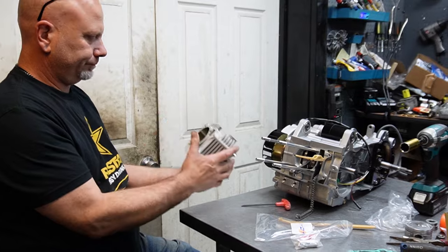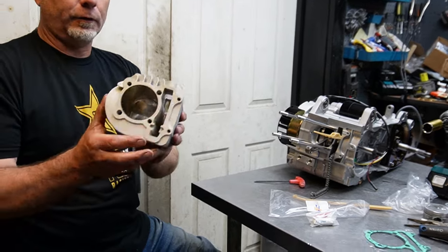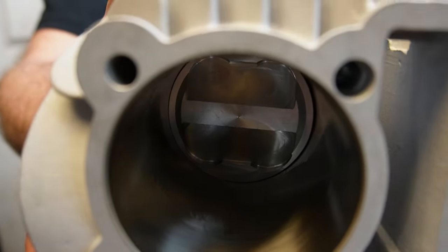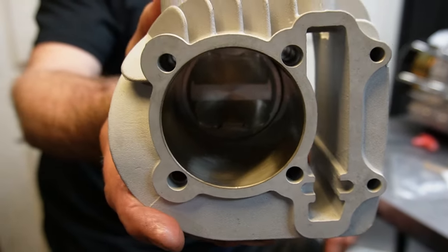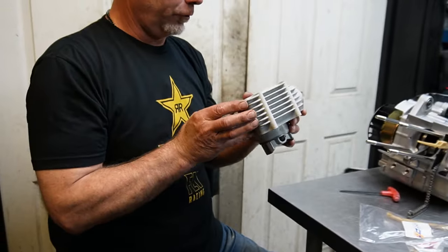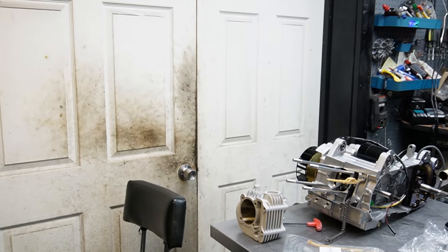There is an arrow. And I'm gonna want to look at the head. The head that's gonna go on is a four valve head. I'm not super familiar with the Yamaha Cygnus, but apparently it's a copy of the Yamaha Cygnus, and the stud holes were, you know, a copied head and then re-drilled for a B case. So what I want to do real quick is I have some reliefs. I just want to look at the head and see where I'm at as far as how the valve looks.